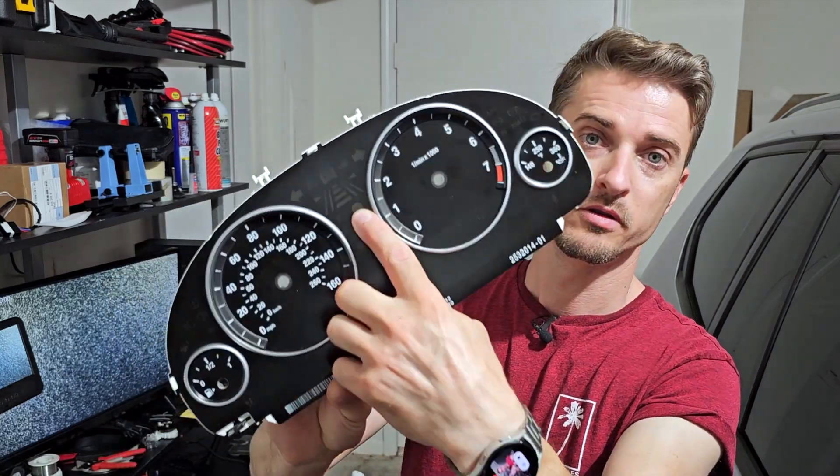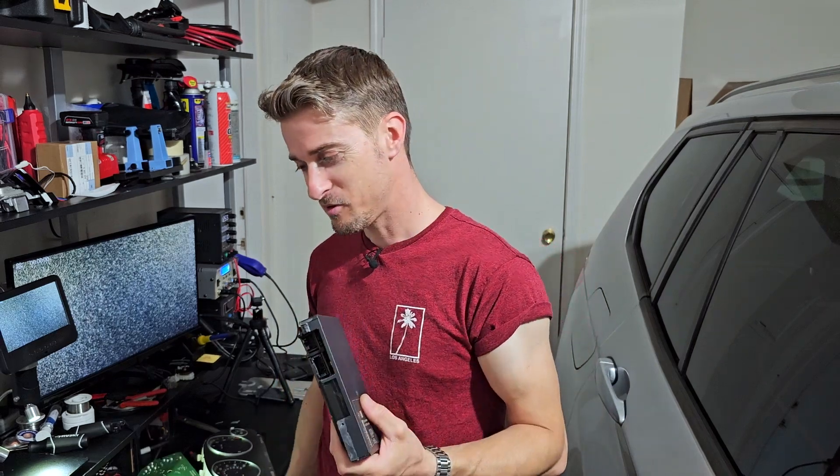Another problem was the climate control — the intensity and luminosity of the LCD screen and the green marking LEDs from the buttons would fluctuate. Every cluster has a photo sensor for luminosity adjustment: when the cabin is darker everything dims, and the other way it increases. I found and cut out that option from the brain, and in the garage everything worked. But when I pulled the car out in the sun, the climate control started doing the same thing. Now I know that on this model, not only the cluster controls the luminosity — even the rain/light sensor from the windshield does.